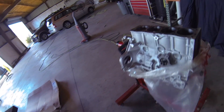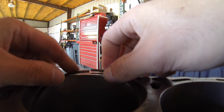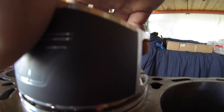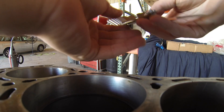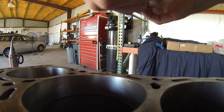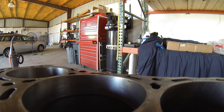This dark colored ring is the number two ring and this is going to be for cylinder number three. I'll place it down in here — you can do this multiple ways, but I just squeeze it a little bit, turn it downward, then grab the piston and push it down just a little bit to level it out. Get your feeler gauge — originally I was going to do 0.022 for the second ring, but these are already gapped at about 0.023.